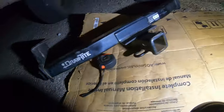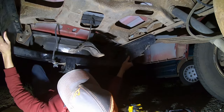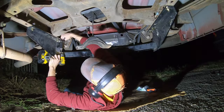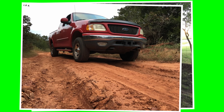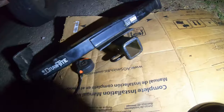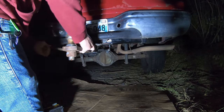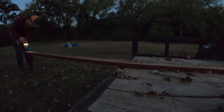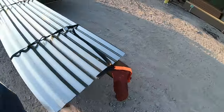Here's how I picked it up yesterday morning. I had to put the hitch on my truck, which is something I've been wanting to do for ages. Funny story — when I bought the truck, I paid $1,650. The guy went down from $1,700, went down $50 because I wanted a receiver hitch and it didn't have one. Like three or four years later I still never got a hitch. I found one for $50 — it was $100 but they took $50 off because it didn't have the hardware. Then I spent $25 on hardware and installed it early yesterday morning. That lowered the tongue of my trailer down, so I took the tailgate off. That way the sheet metal could overhang the back because the trailer's only 10 feet long and it wouldn't drag on the ground. I put some boards out there screwed down to my deck to kind of cantilever and hold the sheet metal, and it worked out pretty good.